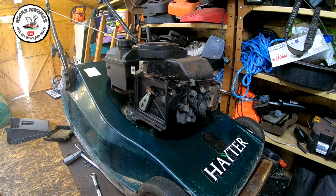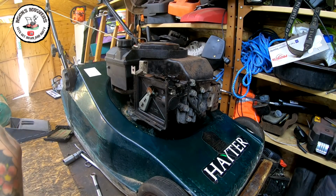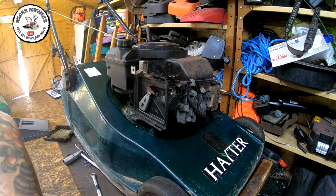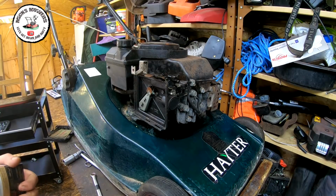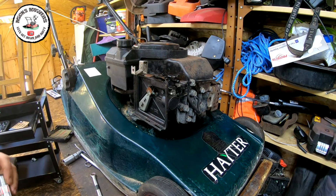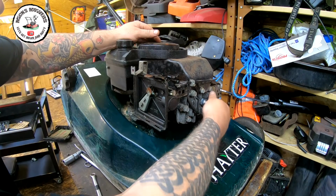I've got some spare spark plugs here actually, which my old mates at Pro Parts Direct gave me, so I might put one of them in. Let me find the old spark plugs. Yeah, these are plugs from my mates over at Pro Parts. They sent me over some Champion ones, so we'll use them up. And these are the J19LMs, which are the same as the B2LMs. Of the two top plug makers I use, it's Champion and/or NGK. So that'll go in. That fits in there beautifully.